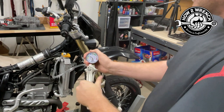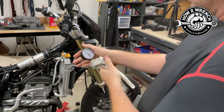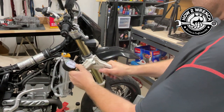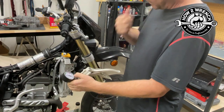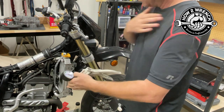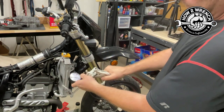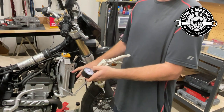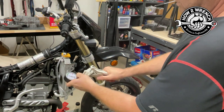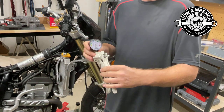I'm going to be test riding this today — woo-hoo! What this is doing is: any air that's in there from the cap being off, it's pushing through all the hoses, pushing through the cylinder head, pushing up against the head gasket, going everywhere that coolant would be and putting the whole system under pressure as if it were running. This is a great test to do when the vehicle is hot — you may not have a leak when it's cold, but then you get the vehicle to operational temp and there it is. So I'm going to go ahead and crank this thing up.